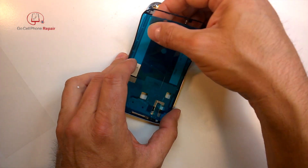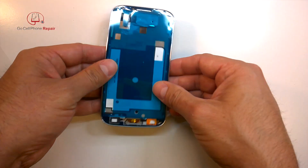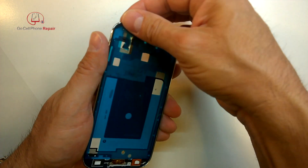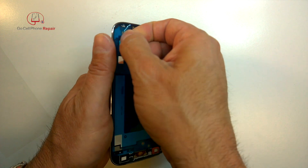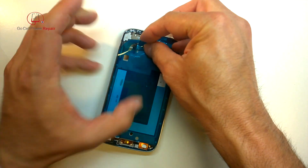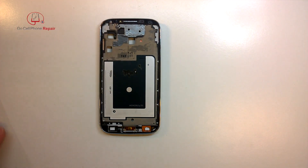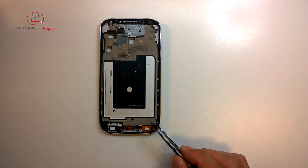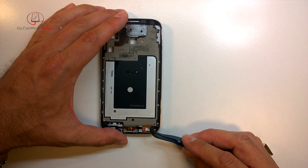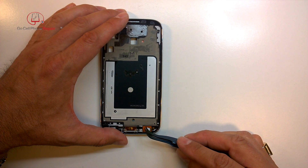You want to make sure this perfectly fits into the frame the way that the original adhesive does. They've got cutouts around all the buttons. This maximizes the adhesion for your screen, which is really important because you don't want the bottom or top edge lifting up over time — the more sticky stuff you have on there, the better. Once you have it applied, you're going to have to be really careful to pull off this plastic sheet because the adhesive likes to stick to it. So just take your time, move really slowly, make sure you get the adhesive to stick to the frame. You can peel it off and be careful down at the thin parts at the very bottom. Now you have a perfect double-sided adhesive application. I did add a little one millimeter piece around the button on the right-hand side because those are supposed to be stuck directly to the glass, so I've gone through and peeled off the outer plastic so that will be sticky as well.